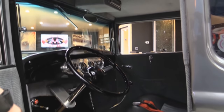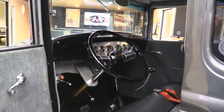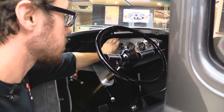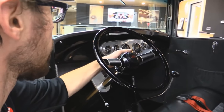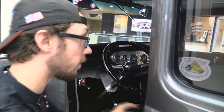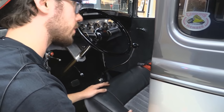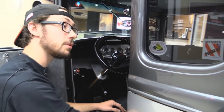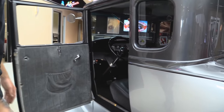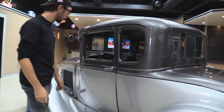The underside of the dash looks good — all kick panels look like they're in good shape. This seat is super, super comfy — it looks like a couch I would put in my living room. All our gauges match in the custom gauge cluster. It's in the center just like Model A's were, but extensively updated. There's a shut-off underneath this seat for theft safety — if you're not comfortable about the neighborhood, pop the seat up, hit that switch, it kills connection to the battery and this thing will not start regardless of how hard you try to hot wire it.